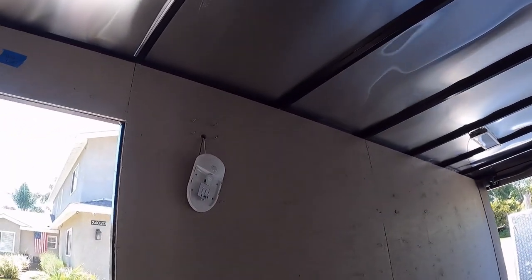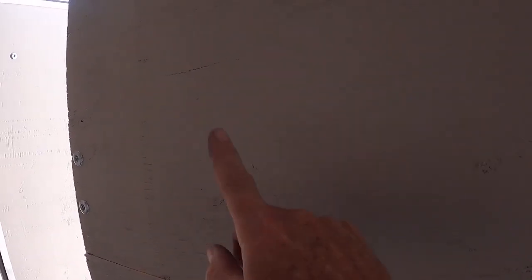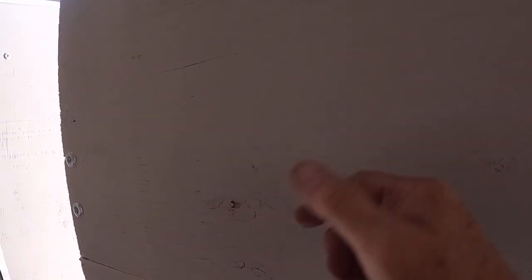There's the original light which only has an onboard switch on it. What I'm going to do is put a box in here for three timers. There will be one for the interior lights - they also have individual switches if you don't need all four on. There will be a timer for the porch light outside, and then a timer for the rear docking lights. As I said, that will also be bypassed with the diode so they can be used as reverse lights.